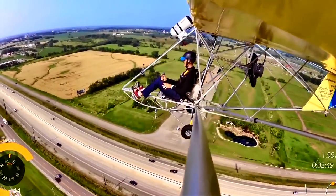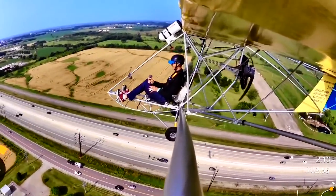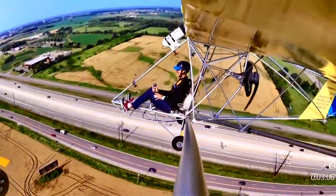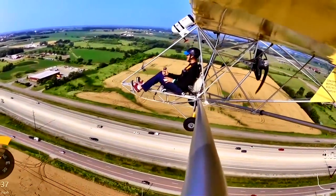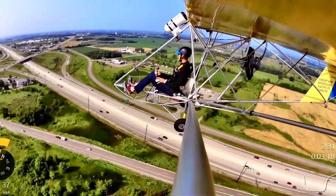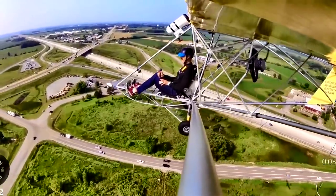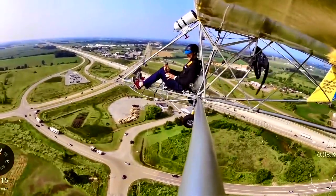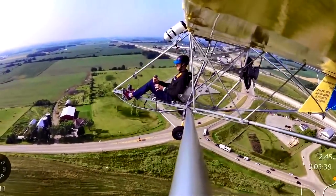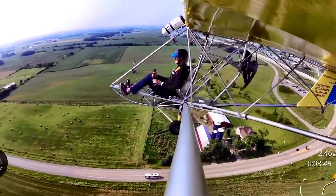You can do that with the Viterazzi motor too, but I'm not so sure I'd start it up again if I've stayed up two or three hours and that engine's fully cooled down. With the electric, if I nudge that potentiometer — that throttle — it's on. No ifs, ands, or buts, as long as I've retained some juice. And that box up front tells me very accurately how much juice is left. It has a calculation specifically for this battery pack and motor — it tells you current temperature, voltage used from the battery, and based on current amp draw, how many minutes of battery you have left. Time left is really all you care about.